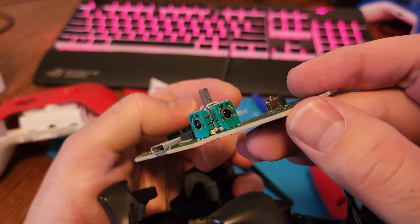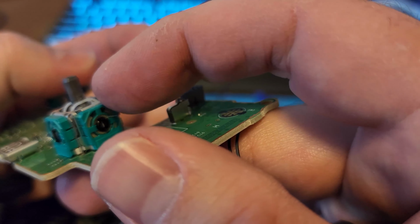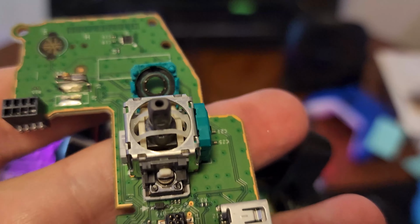I didn't show the teardown of this one because it's the same thing. Nobody wants to watch that twice, but if you look close here, you can see there is actually what looks to be a pet hair on the potentiometer itself, so I do go ahead here and try to clean it the same as the last one. So here's after the cleaning. It does look like it works fine. It is better. It's not drifting upwards, but there is still an issue, as we'll see coming up.